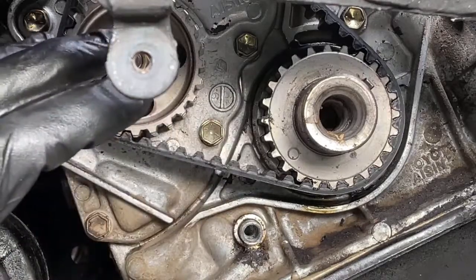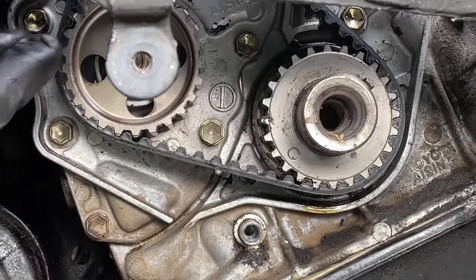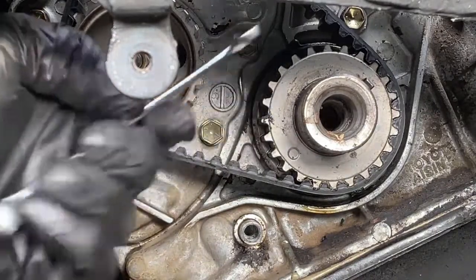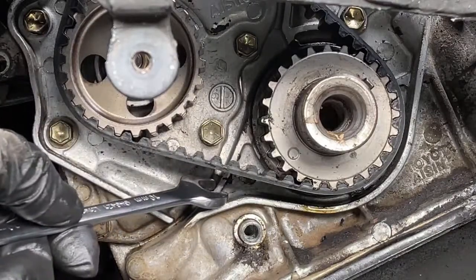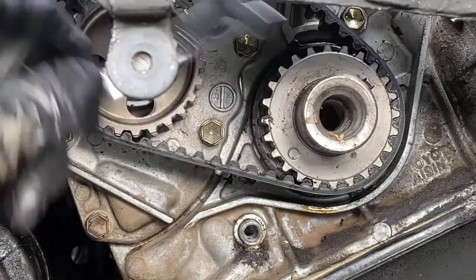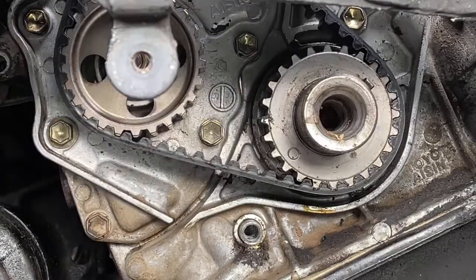And you know, diagnosis is very important so that you don't start throwing crap at a car that it doesn't need, and definitely don't want to tear into this if I don't have to. So I'm gonna put that back on for the third, fourth time, run it again, and see if she's getting oil from up here or if it just starts from here. I think it started from right here and started dripping down, and I think that was residual. I hope it's not another leak. But up here there's a pulley in the way, the tensioner pulley. I don't think there's anything behind that up there, but let's check this real quick.